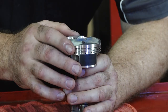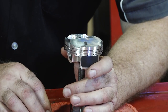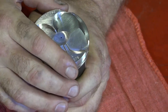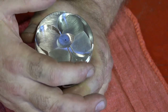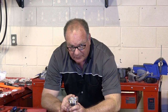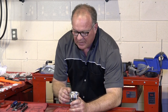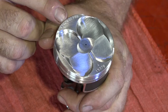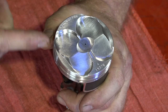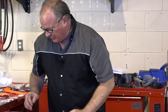What we're looking for is your top ring and your second ring to be 180 degrees out. I typically put the top ring toward the exhaust. Your second ring is going to go right here. Your third ring is actually made up of three different rings — you've got the oil ring and then you've got the bottom and the top retainer. The oil ring I usually follow it back down 180 out from the second ring, and then I put the retentions about 45 degrees off axis from each end. So let's prep the rings and get them ready to go on.